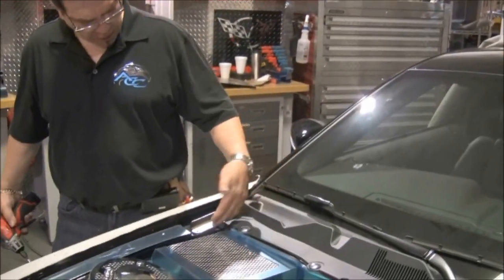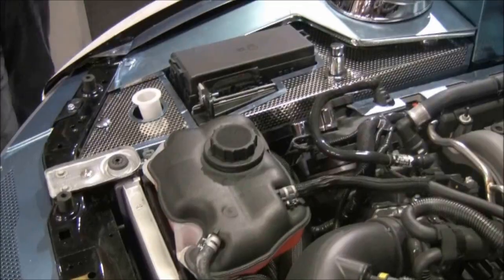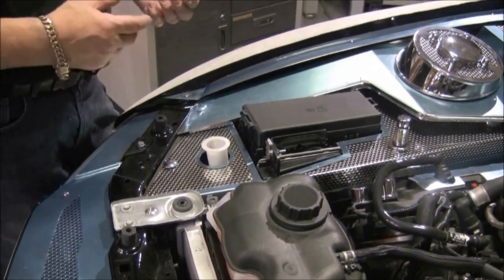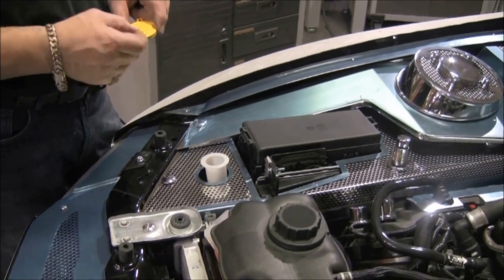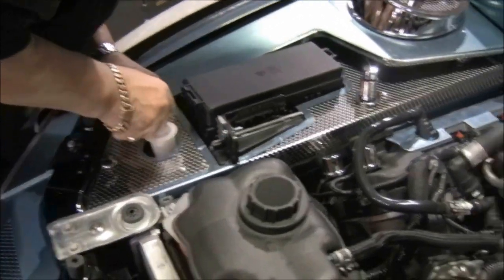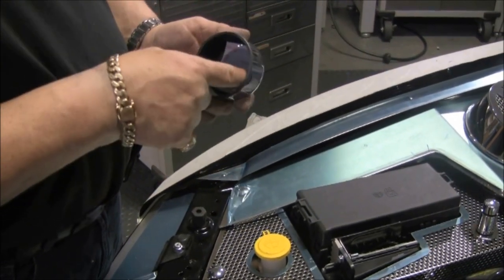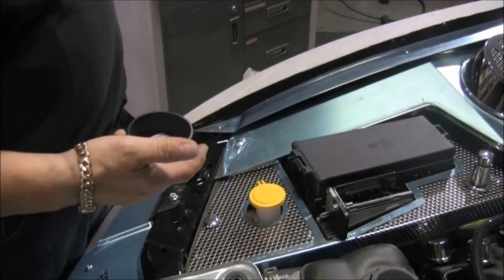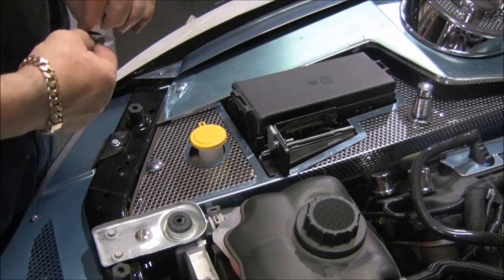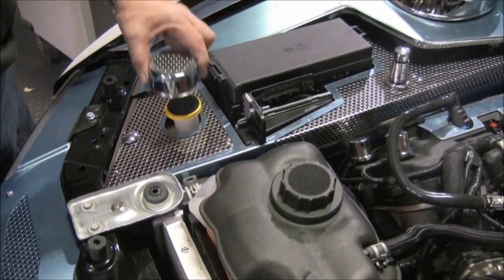You can see we have enough clearance for your hood hinge, and this illuminated panel will reflect on this panel and look quite nice. The kit comes with a decorative cover for your windshield washer fill tank. One of the things you have to do to receive that cover is to just nip off the finger tab that's there from the factory. Once you've shaved that off, put the cap back on and then our cover — this is a perforated one, available in all different styles. Take a Velcro cookie, stick it to the top of your cover, and then set your decorative cover. It finishes that off quite nicely.